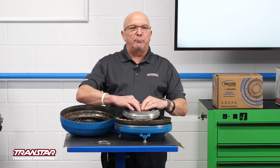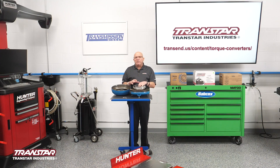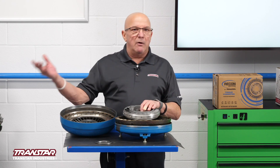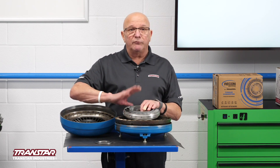There are two ways this will fail. If the sprag or the roller clutch inside of it locks up and won't move, you're probably not going to get over 30–35 miles an hour. It's going to sound like the engine's a jet engine — a lot of noise, but you're not going to go anywhere. The second way it fails is if it freewheels both ways. If it freewheels both ways, chances are you're not going to get the car to move, or barely move. We used to test these by going up to a parking block — if the car will jump the parking block, this isn't bad that way. It could be the forward clutches or something else, but if it'll jump that parking block, it is not this.